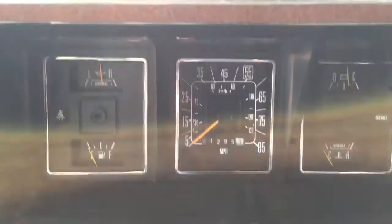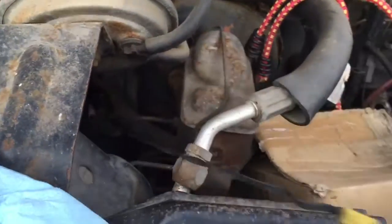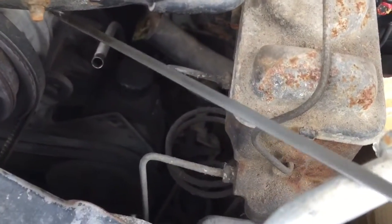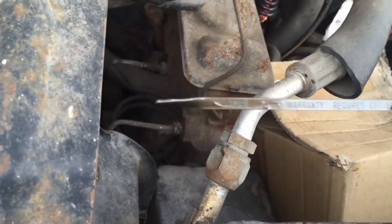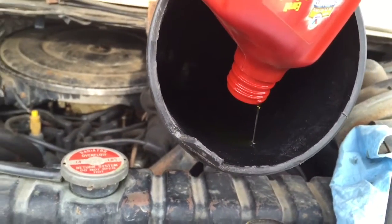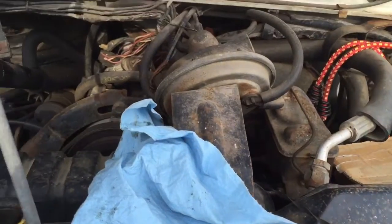We'll just run it for a second and then shut it back off and check the oil. Now we just inspect for leaks after running it — make sure nothing is leaking at the drain plug, and it looks good. After you let it sit for a second the oil will go back down to the pan. Nice clean oil — wipe it off and we'll recheck it. A little bit low still, so we'll finish adding the rest of that quart. This is the last of the quart — we'll give it a second and check the dipstick and it should be good.